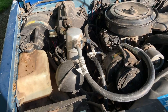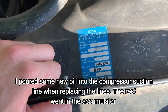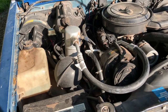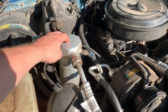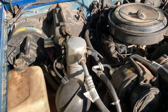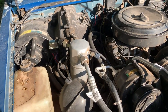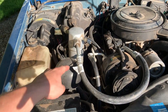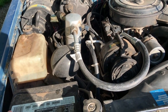That's why you have to make sure to put the right oil in there as well as put on the correct adapter fittings. This system took eight ounces — I honestly forget how I figured that out. I also replaced the accumulator just because they're cheap. It has a desiccant bag that captures any moisture in the refrigerant system, so if you have a really old one or it's been exposed to atmosphere for very long, you might as well just throw a new one on. That got a lot of the old R12 oil out.